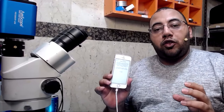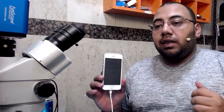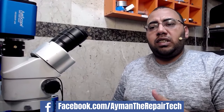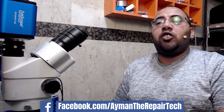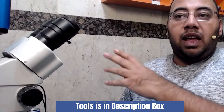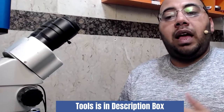The phone is not carrying the correct information — it doesn't have the correct serial number, correct WiFi and Bluetooth MAC address, or the MLB (main logic board number). All this information I need to request from my source. If you are interested in buying this information you can contact me on Facebook; it takes about 36 to 48 hours, or 2 to 3 days, to get it. You'll need to remove the NAND again and use the programmer to write the new information.